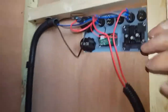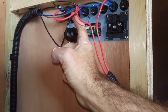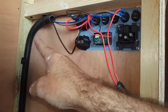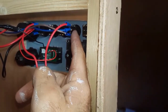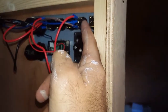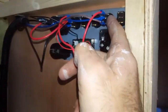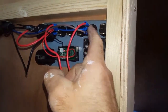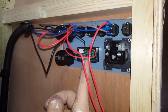I know it's messy right now, but let me try and explain how all this wiring is working. You've got the five toggle switches here, the USB port, the cigarette lighter, and the voltage reader. Now all of these things need to be earthed and they go off down this conduit. On these switches you've got three terminals: the positive comes from the fuse box and battery and goes to the top; the bottom one is the negative - that's an earth, that brown cable goes off through the conduit; and then the middle terminal goes to your appliance - in this case, my lights. On this one you've got the positive going to the fuse box, the earth, and the middle one goes to both the voltage reader and the USB port.